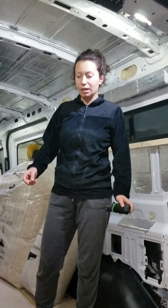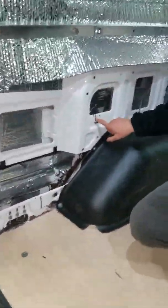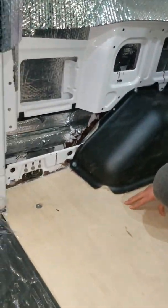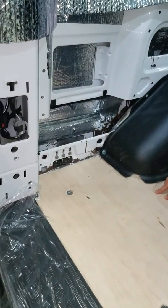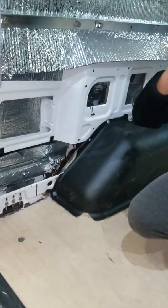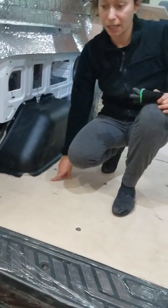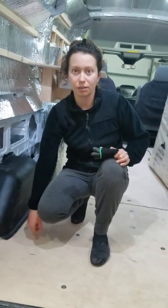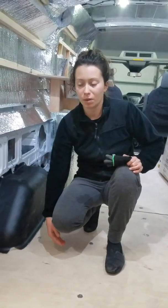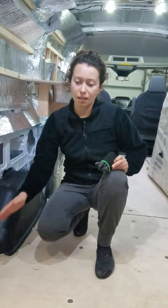The first thing we did was put down some DinoSeal — it's an eco-friendly product. You can see just a little bit of a drip right here. We did the floor with that, about five or six coats on the floor and in the well here as well. Before we put in the styrofoam insulation and the grooves on the floor, we put those in and then did another couple coats of the DinoSeal because we wanted to waterproof the whole bottom of the van before starting our subfloor.